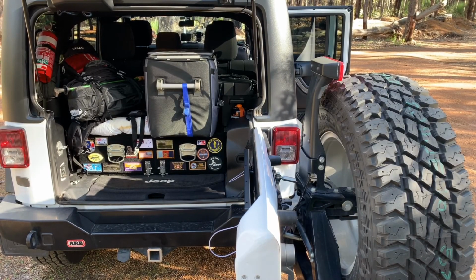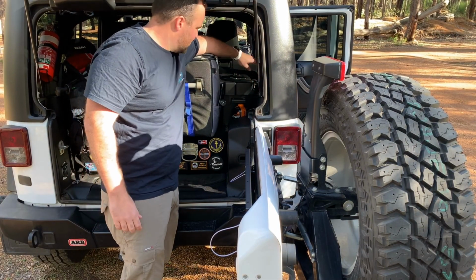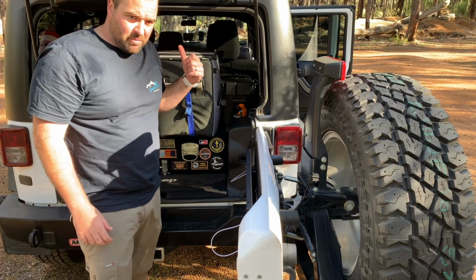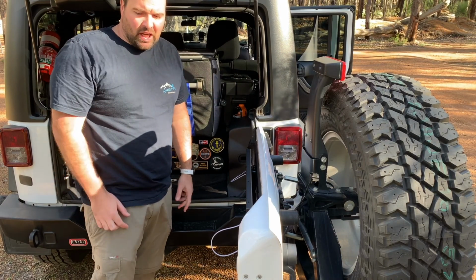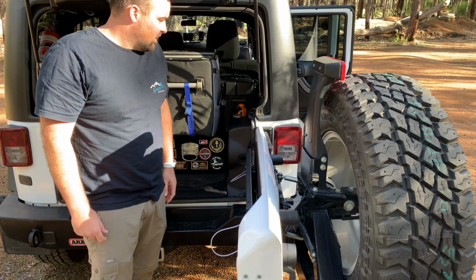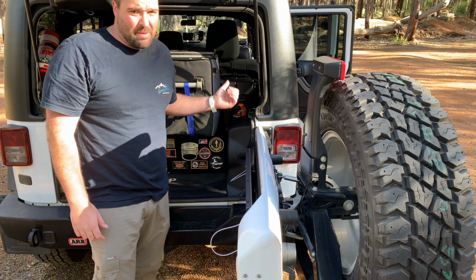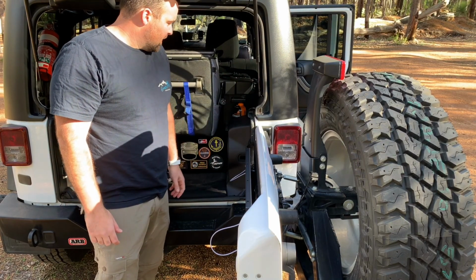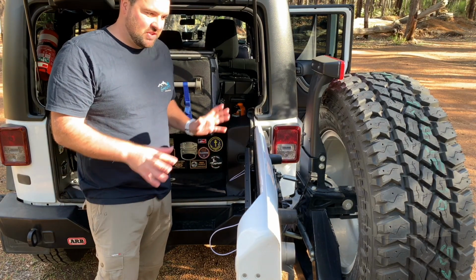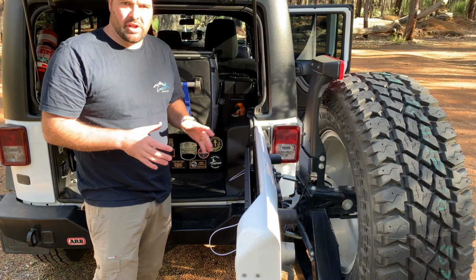So going into the dual battery system, you can see the dual battery box just there. It's got a number of outlet sockets, USB. It's got an Anderson plug to charge off the VSR straight off the battery, as well as I've now got a solar blanket that I'll either lie on the roof, windshield, or the deck somewhere to get some extra electrical sun juice into the car to top up the battery. 120 amp hour, it's more than I need. And to be honest, I really enjoy it. It's a kick-ass system. There's some of the cheaper systems that you can buy, but the actual batteries are quite decent quality and will last.